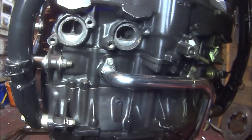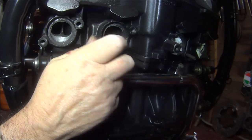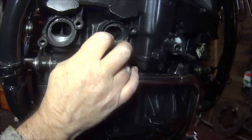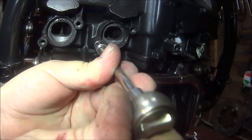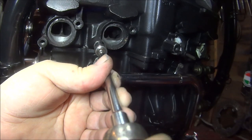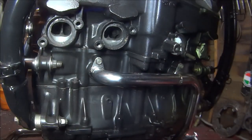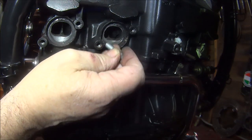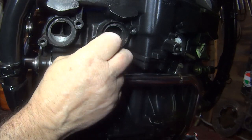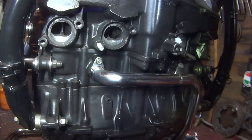But first I'm just going to use the bolts to clean these bottom holes out. I haven't got a tap and die set - well I have got a tap and die set but they haven't got this size - I'm just going to make sure they all screw in nice and freely. That should do. Back out, and now hopefully I could screw the new home made stud all the way in with just my fingers. Yes, perfect.